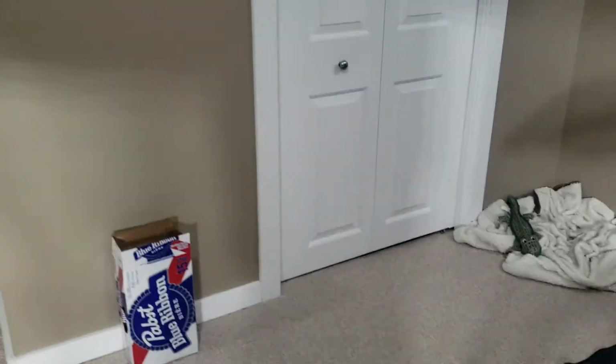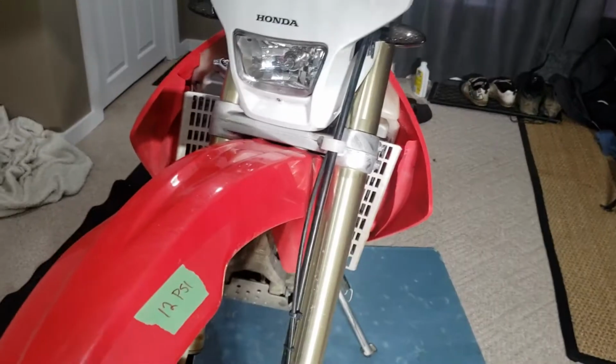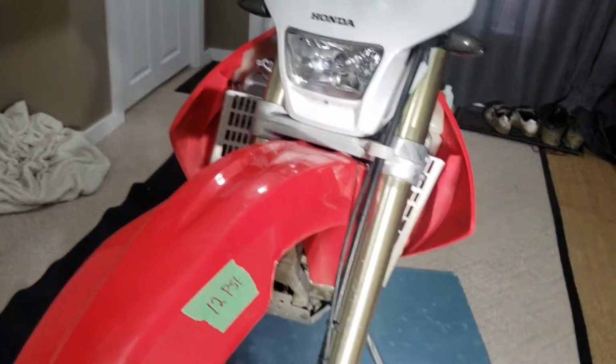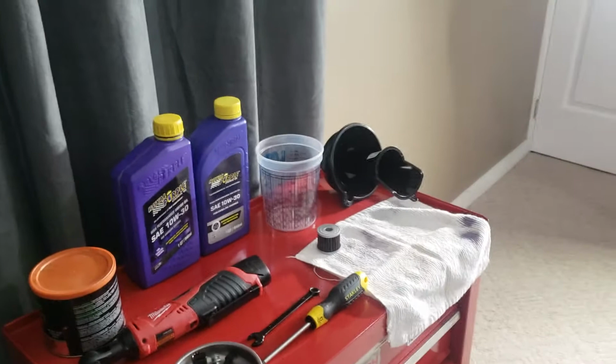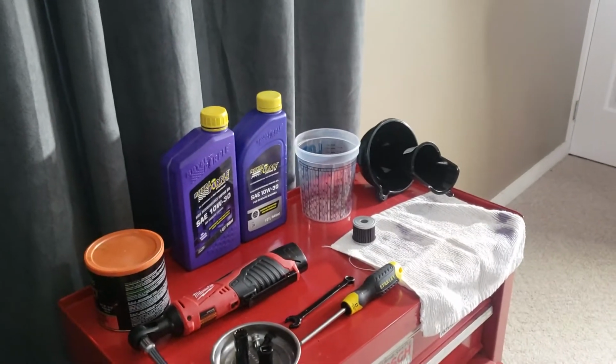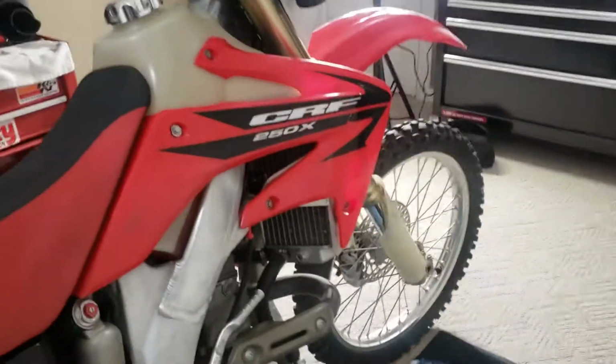Then you put back in, what was it now? They call for, let's see, 690 mils of oil. Do your drain plug back up, 16 foot-pounds. Measure the oil out. What did I say? 690 mils. You probably have to top it up again. Okay. Then we go over to the transmission side.